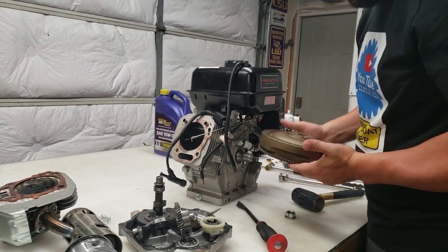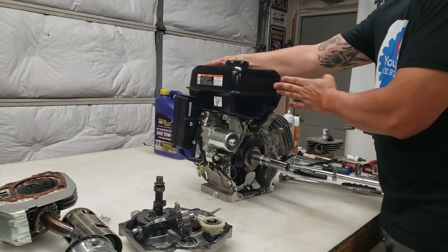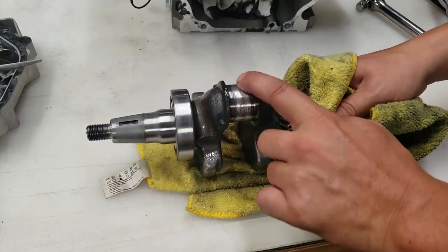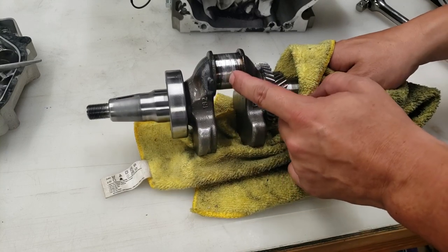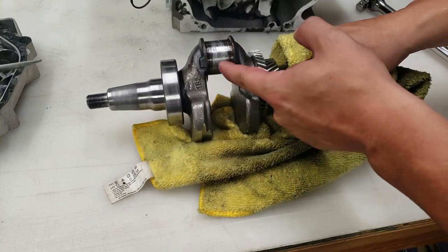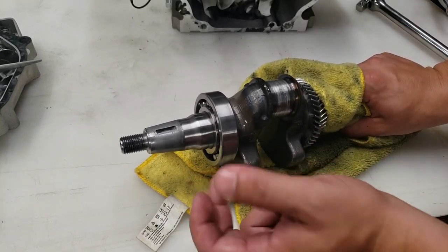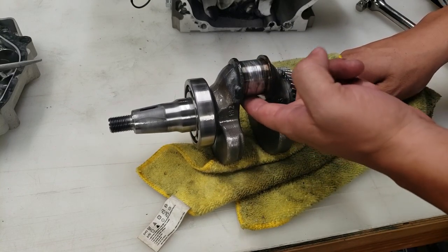Flywheel still looks good — we'll talk about that in the next video. Looking like this crankshaft may be gone like freight train, gone like yesterday, as Montgomery Gentry would say. It's got some pretty significant scoring on there. I don't know if that is the actual bearing surface that has kind of heated up and transferred over to the crankshaft — you can actually see the heat signature mark right here. The bearing seems to be okay. I might have to take this thing and see if it can get polished if it's still in spec, but I highly doubt it.